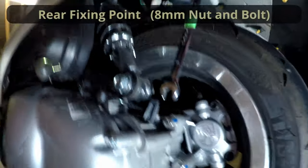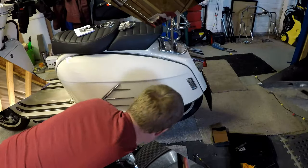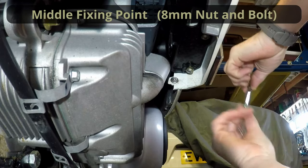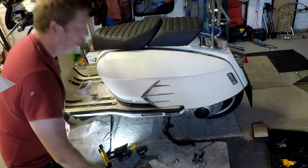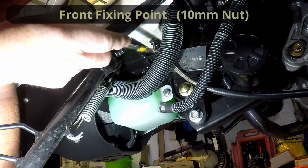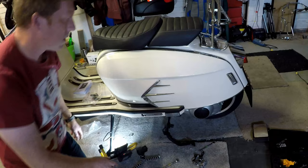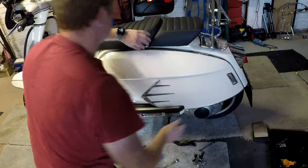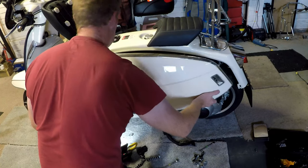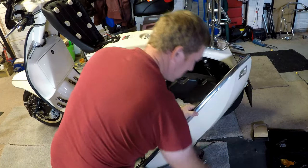If you follow that spanner up, you'll see one of the bolts, 8mm. Next one, which is just here. So 1, 2, 3, well, I've got this one. If you can see on this camera, this one's a 10mm. One, two, three, lift off, lift the seat. But to be honest, that's not hard. You know, people say it takes ages to take these off, it doesn't.